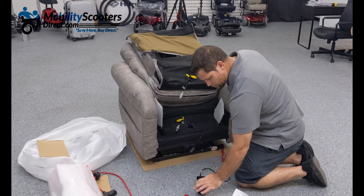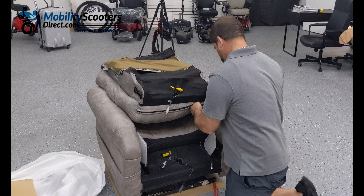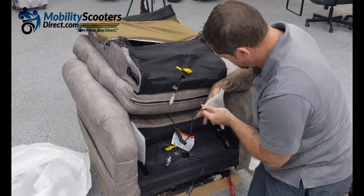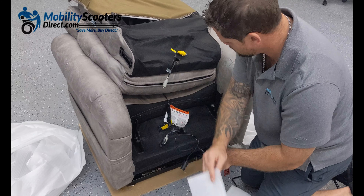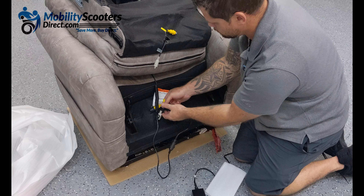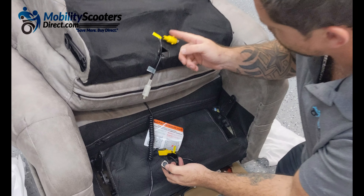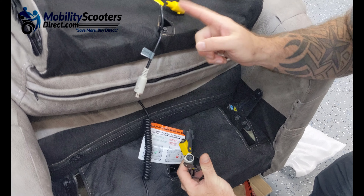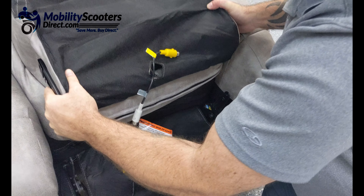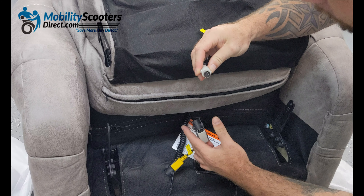Now the trick to connecting the remote is to get the remote right through the middle of the chair. The wire is going to go through the gap between the top and the bottom part of the chair, so make sure you connect the black to the black and then slide that remote through the middle. The next step is going to be to connect the yellow and gray connectors respectively. There is no trick to it — you may need to move the top part of the chair a little bit closer to you so that the wires can reach, but there's no wrong way to do it as long as you're matching the colors up.